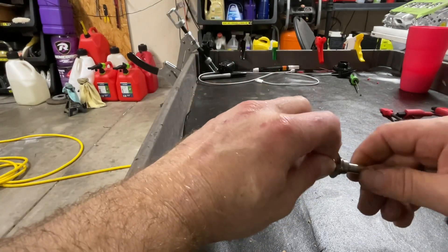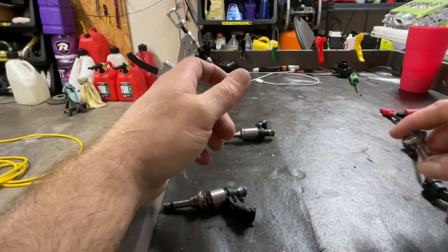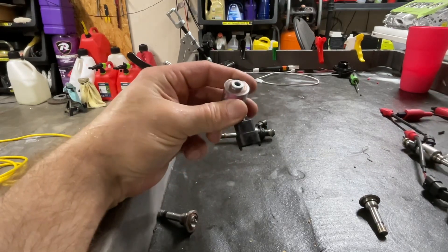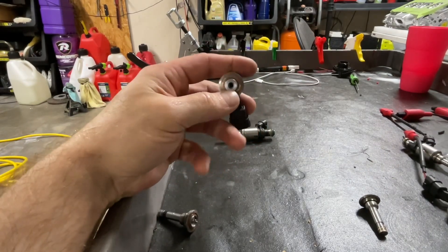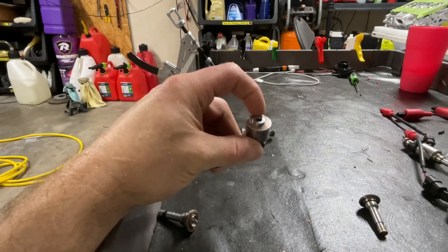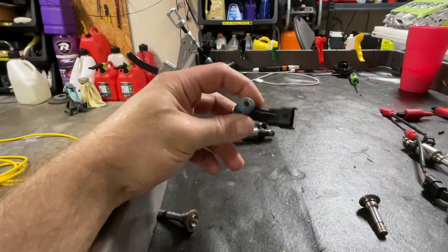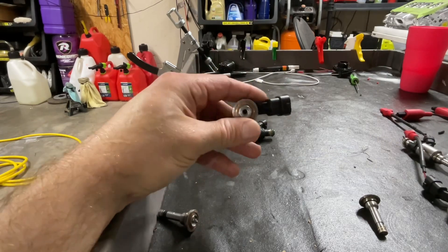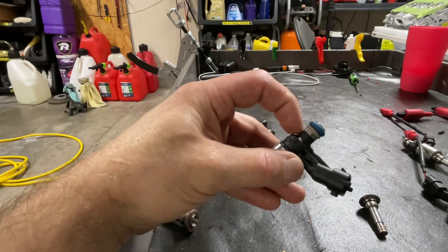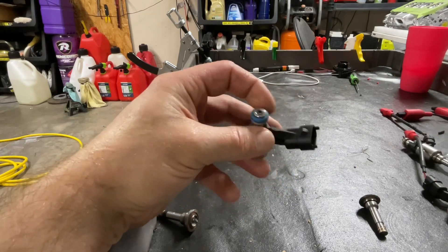There are no metal surfaces to wear out because it is self-located directly in the middle. The only way they'll generally wear out is if you somehow manage to burn out the coil — all HD EV injectors use the same coil — or if you get some form of external contamination. They do have a screen, though unfortunately I can't get to it as it's buried down in here, but that pre-screen mostly protects them.